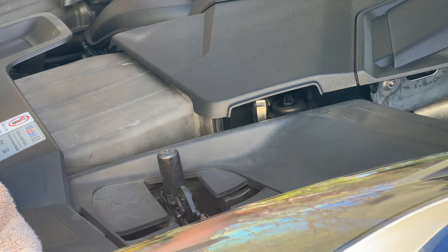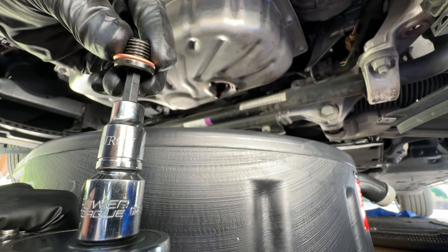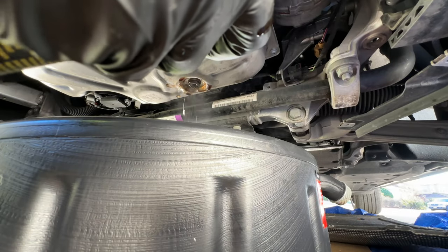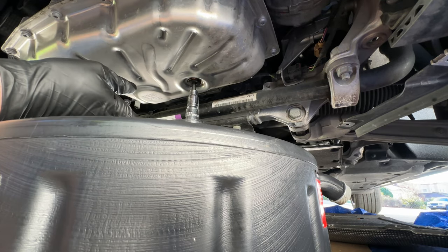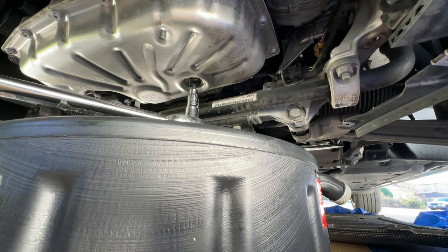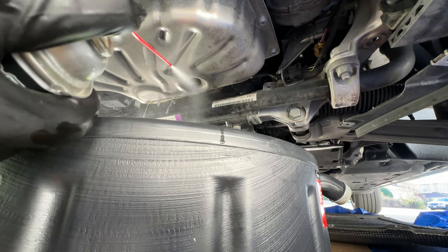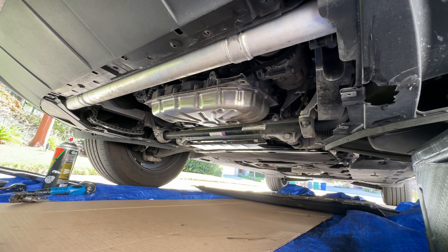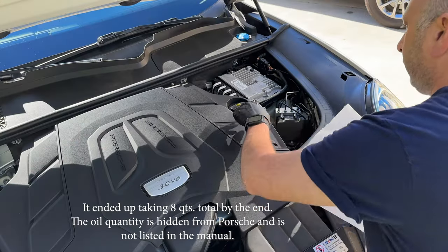With the air box lid fully down, clip it in place with the two metal clips. Next, install the new drain plug — this is the Conoco one linked below — using a 6 millimeter hex. Put it in by hand first, then clean off any residual oil. Torque it to the standard 37 foot-pounds. After it's torqued up, wash it off one more time so you'll notice any oil leak if it were to happen. Then put the belly pan back on using the T25 bolts.